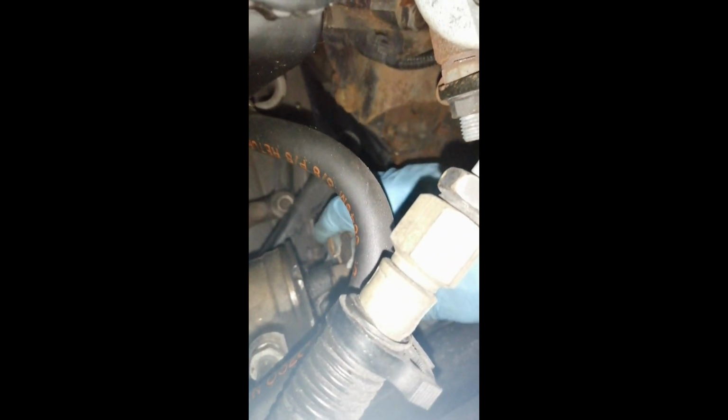Bring the whole thing back, and instead of having bolts on the old one like here, on the new one, well, this side I'm pretty much gonna have to grind down and push those old bolts through. So what I did is put the pry bar up in between the steering box and the shaft and just push it out.